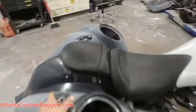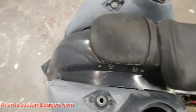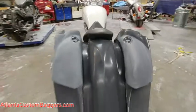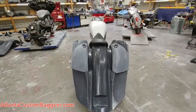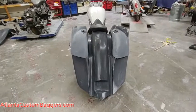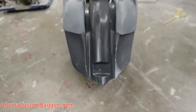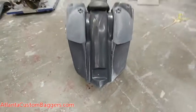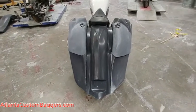These will come pre-finished on the inside. This is just a mock-up set. Our bag mount kit for this is going to be bolted on underneath that fender, so you don't see the bag mounts protruding out from the bike. It does connect all the way around from bag to bag behind the rear fender. We do have a center adjustment point that'll be behind your tag. It's also adjustable up and down, left and right, so you can get the best fit possible.